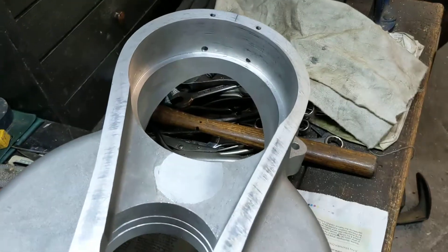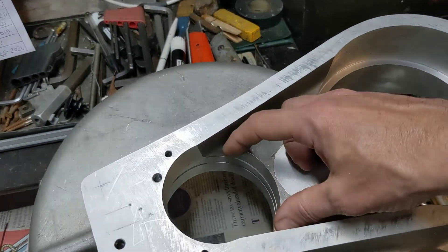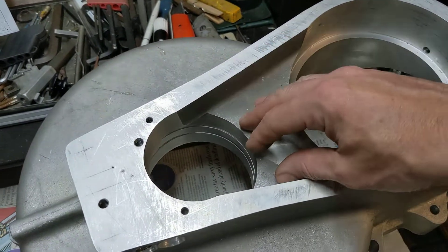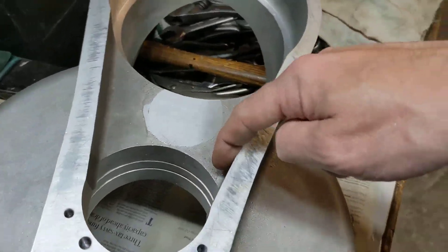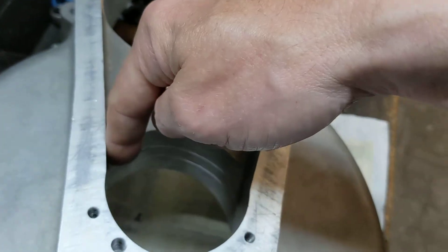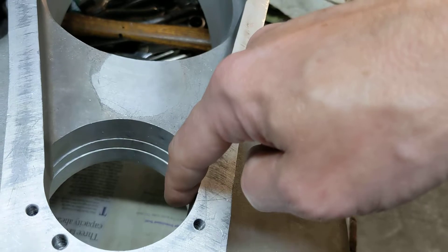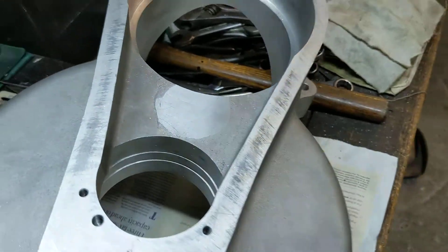While Bob's going on holiday, I'm going to machine this down slightly to make a bit more room for the timing chain, because it's a bit close to this edge here. I'll also just take this edge off with the mill, because the timing chain is a bit close here and here as it goes around the sprocket.